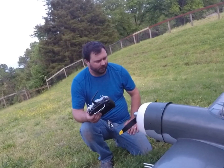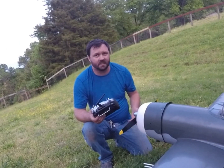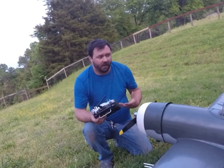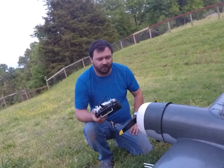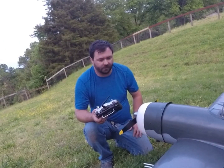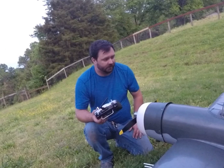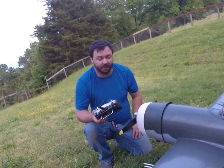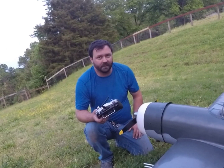In closing this video — engine runs good. Some guys say that the FG-60 is not enough for the Top Flight P-47. I think it's plenty. I fly this thing around third to half throttle most of the time. If you want to do a loop, go ahead and give it all the beans. But as far as rolls or any maneuver, three-quarter throttle will do it. It's by no means an acrobatic airplane where it can prop hang and all that, but it flies very well for what it is. I really enjoyed this plane. I want to say thank you for watching this video, and for more videos like this, stay tuned.